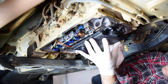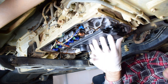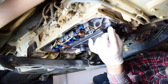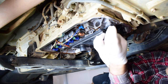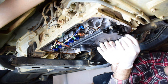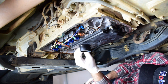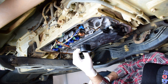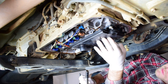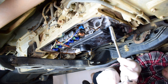Now we can line it up and push our filter up into the housing. I'll get the bolts and do those up finger tight first, then tighten them up with the ratchet after. Those three bolts are now holding up the transmission filter and the o-ring is sitting in there nicely. I can just tighten these up — they should be tight to around 10 Nm.